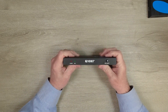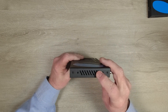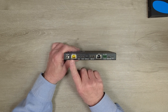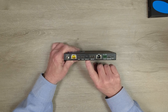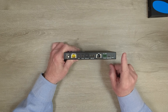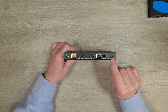As for the receiver, it has the same indicators on the front — power and ARC. Power will come on once the power-on self-test completes, and ARC will come on if you select ARC from the HDMI connection. There are ventilation slots on the bottom and sides, and mounting holes for the bracketing. On the rear, a similar set of connections: you can choose to plug the power supply into the transmitter or the receiver. There's also the LAN port for the cable running between transmitter and receiver, infrared in and out ports, optical SP-DIF audio connection, the HDMI out connection to your monitor, a 100BaseT LAN port for connecting a computer at the remote location, an RS-232 connection port with an included connection block, and a service port and switch.